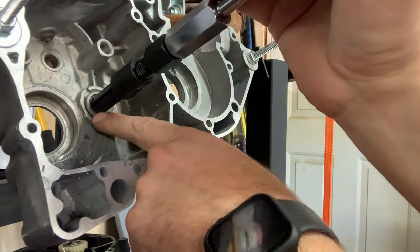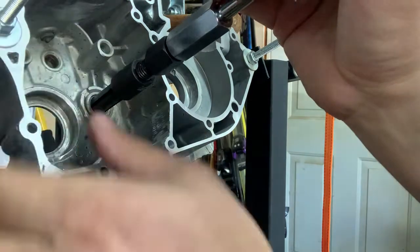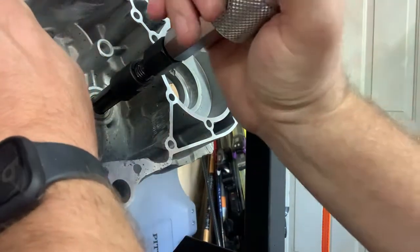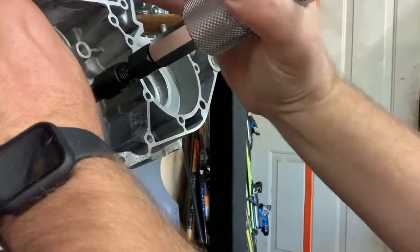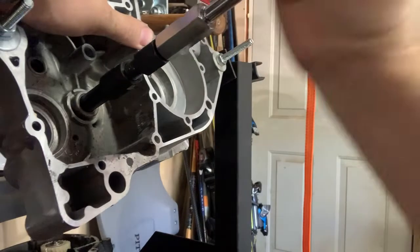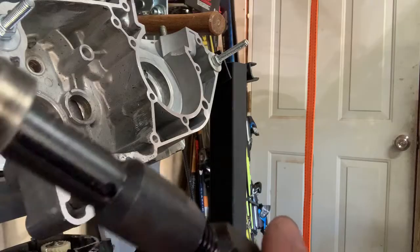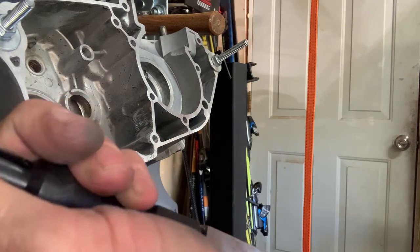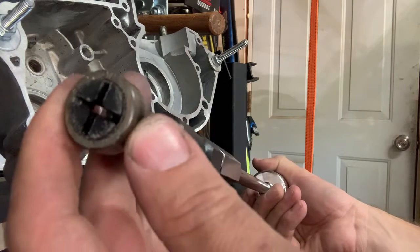It's coming — now I've got it past that lip about an eighth of an inch. Any one of these times it's just going to hit me in the face when I hammer back, so now I'm starting to be careful, hitting lighter and lighter. There we go — there we go. You can see I can still almost move this bearing around just a little bit; it doesn't need to be super tight on there, just enough to where you can't pull it back through.